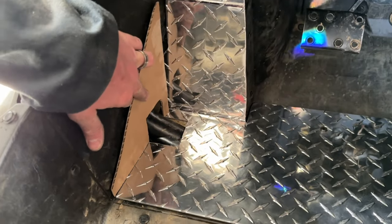We finally got the part back from welding — everything went pretty good. I used a rubber mallet and lightly tapped the left side to bend it into a slight arch, because the left panel comes in on an arch. Just lightly tapping aluminum with a rubber mallet — don't hit it hard — I was able to get it to bow and fill that gap. Everything's welded on solid: top plate welded on, cutout for the frame piece at the bottom. Next step is to sand it down with a flap disc on my grinder.